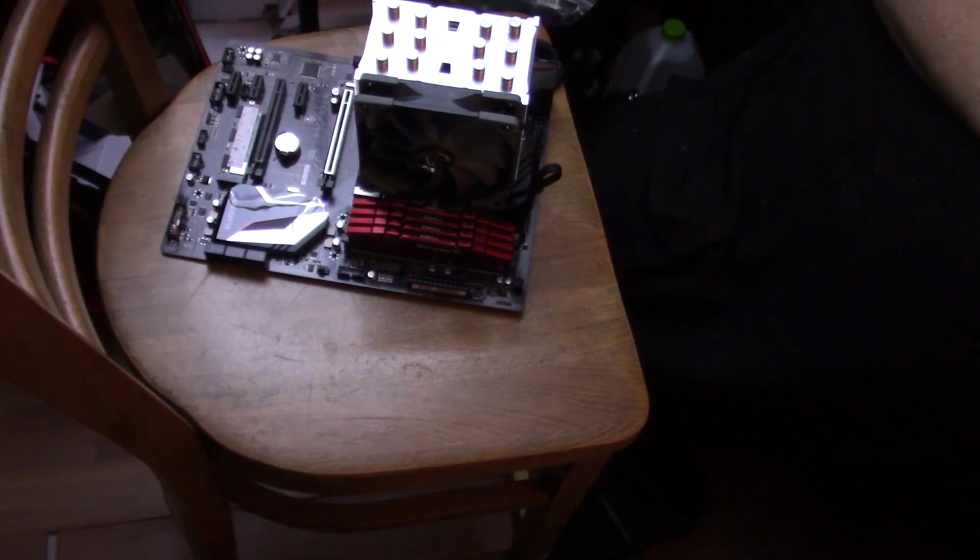So I'm a little mystified because I have an 8-pin. So the cables are marked PSU. That's because it's going to connect into the power supply. And then we have these pairs. Now they're split apart in case you have only a single 4-pin connector.